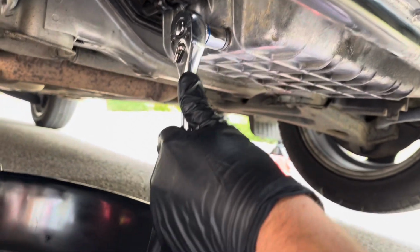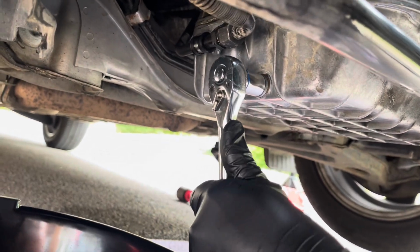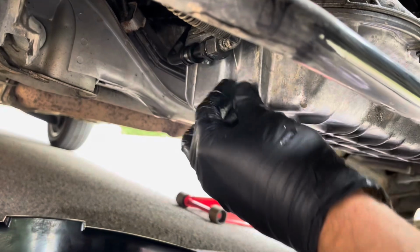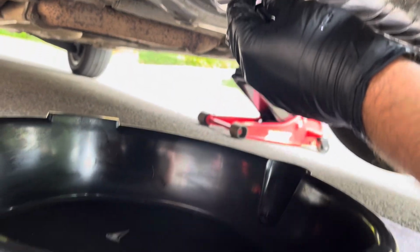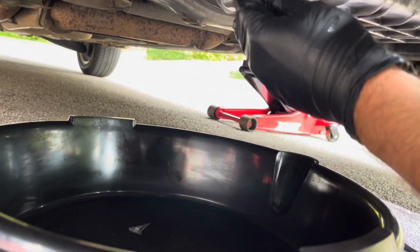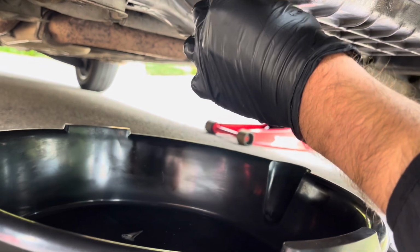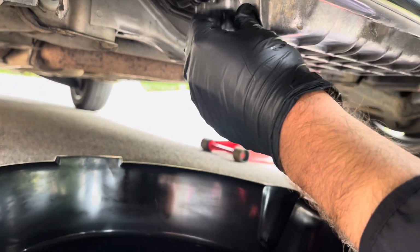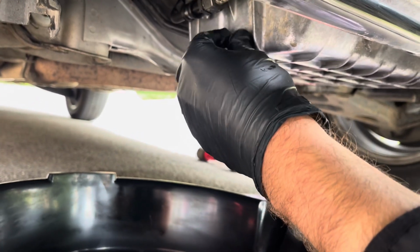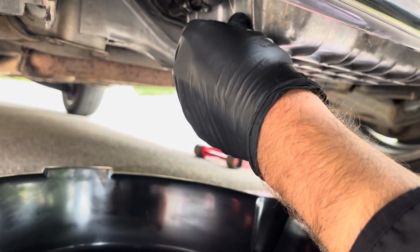So once we've removed the old oil filter from the oil filter housing, we can now drain the old engine oil. So take your 13mm wrench, and usually it should, there we go, come undone. So luckily this one wasn't held on very tight. Make sure you have your drain pan and be ready, because it is very hot when this comes out. Obviously it's been a running engine, and any second now we should have it drain.